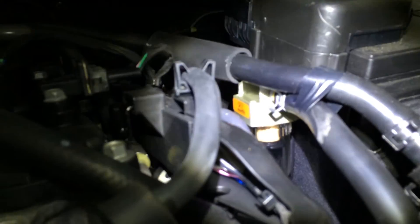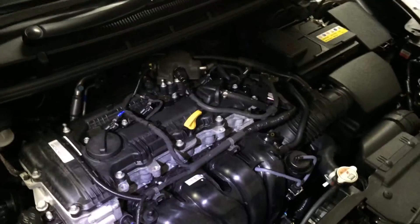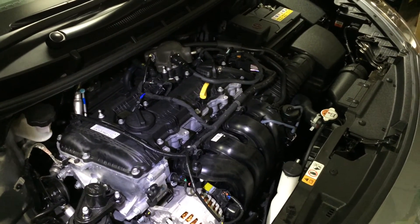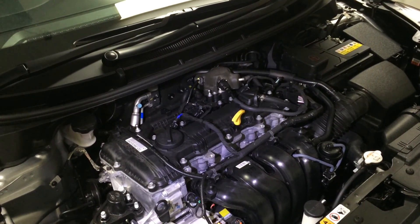The other thing I did is that bronze element you can see in the oil water separator — I've kept it all original except I've drilled four 5 millimetre holes into it so that it won't get blocked and will allow a nice air flow through it. Really the only function of the bronze bush itself is to hold the little baffle in there, and it has a nice arrangement where when the air enters the chamber it's in a rotational movement — almost like a vortex — helping it condense down into the liquid nicely. Pretty easy to do all in all and pretty effective. Ideally a real catch can from a proper manufacturer would be good, but I think in this case it's worked well as a temporary measure.